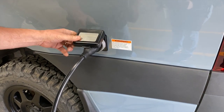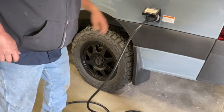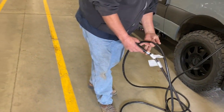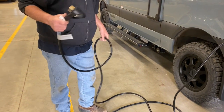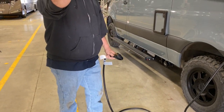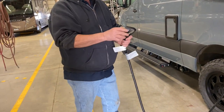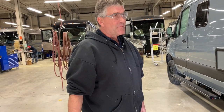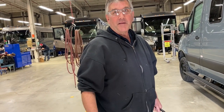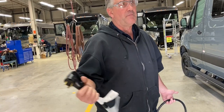What do you find as far as campsites — would this cord be plenty long most of the time? Probably. But if we want to hook it up to our house or something — yeah, if you're only going to hook it up to 15 amp, which is your basic household deal, you can get a pigtail that goes from 15 to 30. With this one you should be able to run off that. If I can plug in, I'm going to plug in.